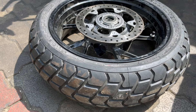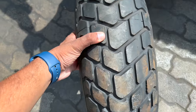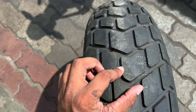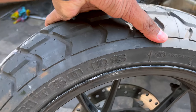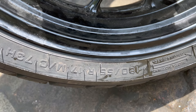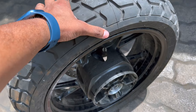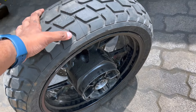There are different segments — 50% off-roading, 30% off-road. This tire is 30% off-road. This tire has very deep tread — it is valuable and gives good traction. In every tire there are markings — this one is written here as 180/55/17. The 55 is the profile and 17 is the rim size in inches — it is the diameter of the rim. By this way you can change the tire in the same size.